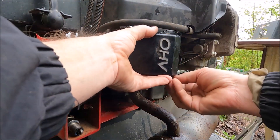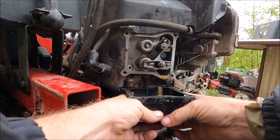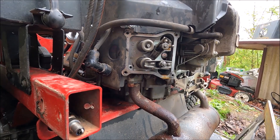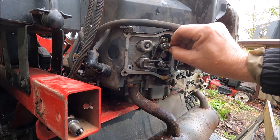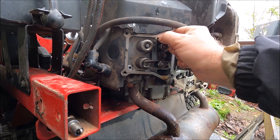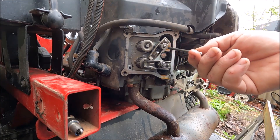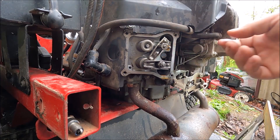A little oil may come out of this so I'll try to catch it. Look at that — the lifter has moved on us, so the push rod isn't pushing on anything. That's actually a pretty easy fix.